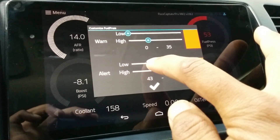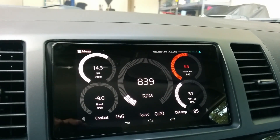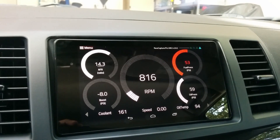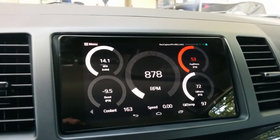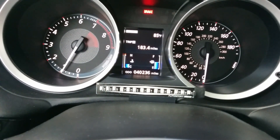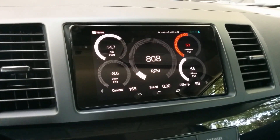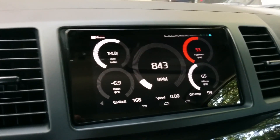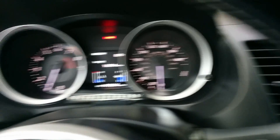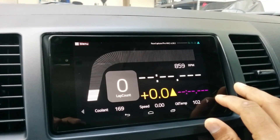I'm going to make a trigger right now — I'll set it to 238 so it goes red. I keep it simple: red means something I need to pay attention to. I don't really focus on the tablet unless there's a special need, but a color flash gets my attention. For really important alerts, I have the Autosport Labs Shift X, a three-stage sequential shift light. Using Lua scripting, I can say: if fuel pressure while above a certain RPM drops below a threshold, trigger the center stage red and flash at set intervals.